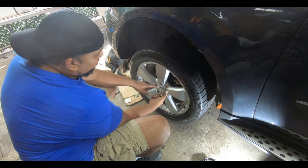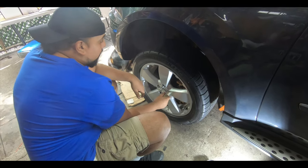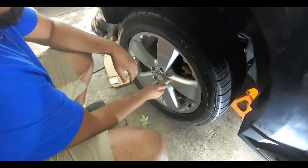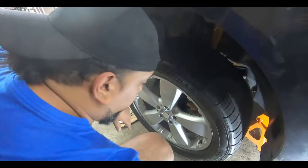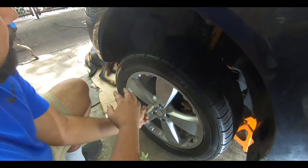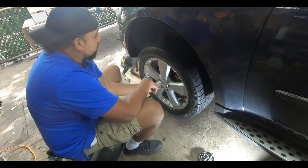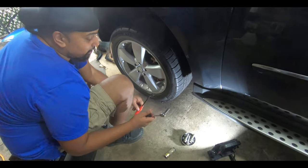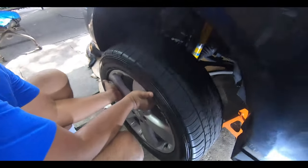We already got some of it off. We're also using our wheel hanger so that the wheel doesn't drop off and hit the caliper. The wheel hanger — I don't know if all ML 350s come with this — is where the spare tire is. You'll see it in the foam, it has a foam spot molded into the back. Now, you might be able to get this done with the tire on, just turning the wheel all the way out, but so you guys can see a better view, we're going to remove the rim. We have a 10 millimeter socket and a prying tool to take out the push pins.